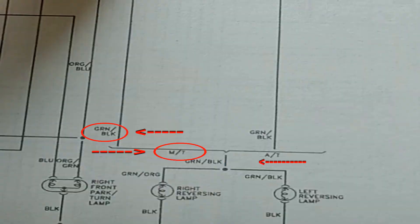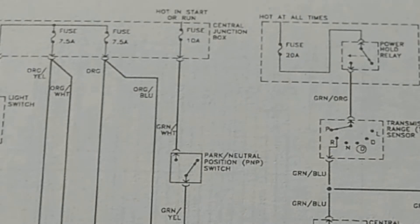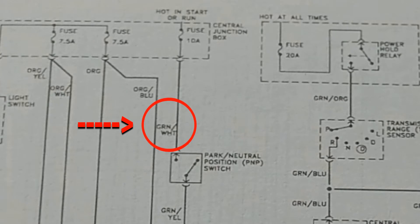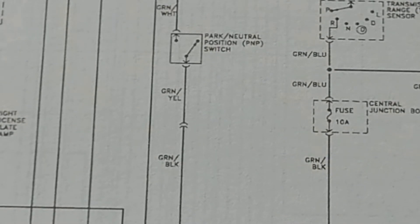The wiring diagram tells you specifically what the wire color is on this specific vehicle so you can locate it. If you don't know what the switch is or where it's located, you can at least narrow down your suspect based on the color of the wire. The diagram shows the wire going from the fuse which has power — sometimes the wire changes color along the way, as it does in this event. That allowed me to figure out which color wire plugged into the fuse so I could locate it inside the vehicle.